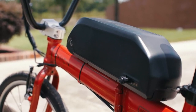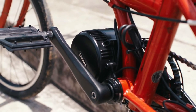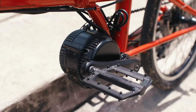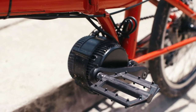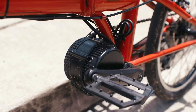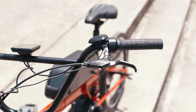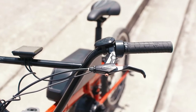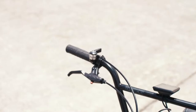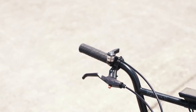When you were going through the process of building it, what was your first step? When I first saw the bike, it was just the rims and the frame. The sensors for the motor is probably the biggest one, then making sure you have a solid drivetrain that can handle it, and your gearing is important. You also need to map out where you're going to run your wires so they don't get tangled up in your brakes. You want to have a good plan of attack before you start the process.